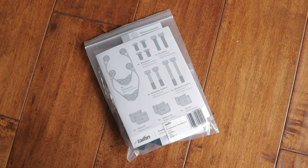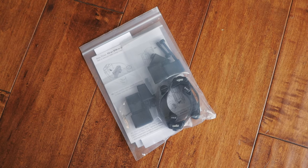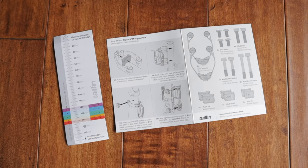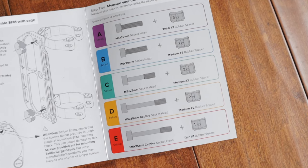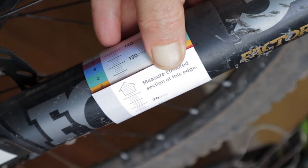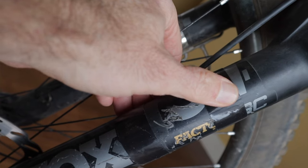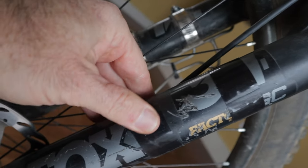Alright, let's get to the nitty-gritty. When I first opened the package I was struck by the exceptional attention to detail. A bunch of little ziplock bags keep all the pieces organized, and there are detailed instructions and illustrations to make installation foolproof. There are also videos available to watch, but it's pretty straightforward. Tailfin includes a measuring device that you wrap around your fork leg — it's color coded to help select the proper bolt and rubber spacer. From there you install the clamps loosely on the fork, add the cargo or bottle cages, figure out the height on the fork leg you want, then wrap some self-fusing silicone tape on the contact points.